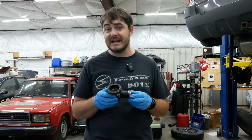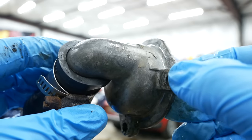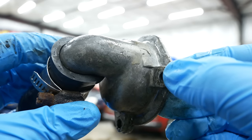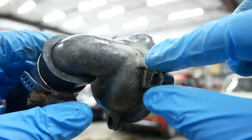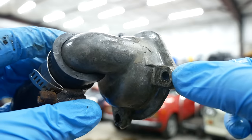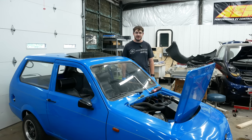I found the leak. I bet the thermostat gasket was fine — the housing is cracked right here. You might even be able to see it. What probably happened is I over-tightened this bolt, pushed that foot down further than the rest of the housing, and cracked the thermostat housing. That's that — I've got to order a new thermostat housing. As soon as it arrives, I'll be installing it, because the Robin is incredibly in my way. So you won't have to wait too long for a follow-up video.